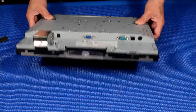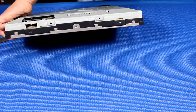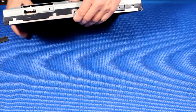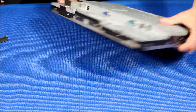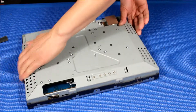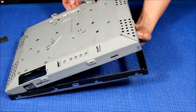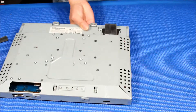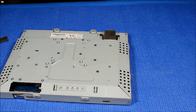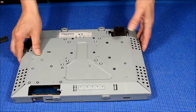This touchscreen is pretty easy. There are screws — one, two, three, four — you just have to remove the screws and then take the touchscreen out. I already did that to save some time. After you remove the screws, you just pop it up. That's it — the screen and touch interface are out.